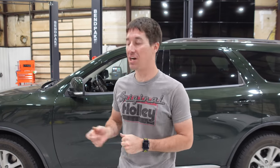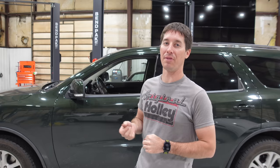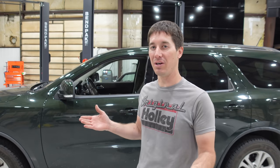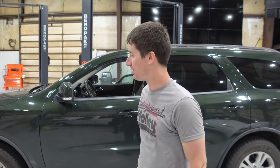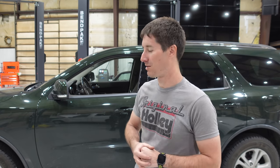The Durango is back on the road better than ever with a brand new wheel hub. Obviously it was something that was very much needed — 118,000 miles on the thing now. We started hearing the first rumblings from it at around 112,000 miles, and it became a real drone and then a squeal at low speeds. This was a massive job. We had this penciled in to be about the normal 28-minute wheel hub job — pull the wheel off, take out the three bolts, hit it five times with the hammer, it falls out. That is not what happened today. It took four or five hours, about 20 to 30 minutes of heating with two torches, and we kept beating on it. We must have hit it with the sledgehammer until — I can't believe the upright didn't have problems.